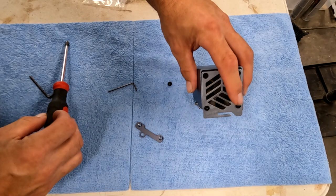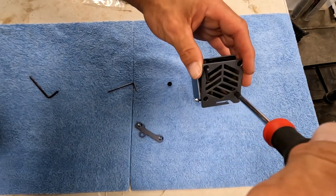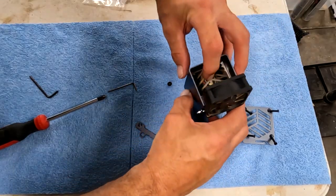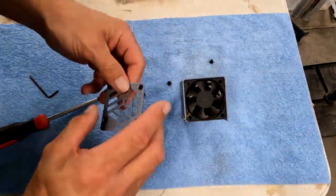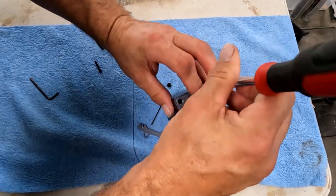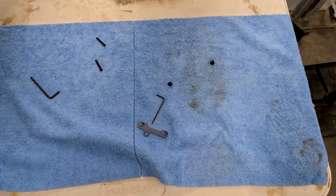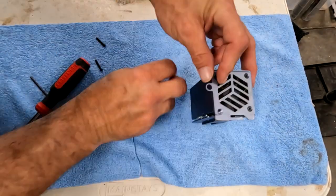Be careful when you take the fan out of there. There are still two wires holding the fan to the laser to make it run. When you lift that up, lift up slowly and evenly, don't pull the wires out, and don't lose that little metal piece down in there. I'm just using compressed air here to blow out the fan. You can use a can of duster if you want, and just make sure it's all clean on the inside. When you line those screws back up, make sure you don't tighten them all up yet — put them in first, get them started, and then tighten them down. Your fan will slide around a little bit, and it makes it difficult to get the screws lined up if you put them all in at one time.